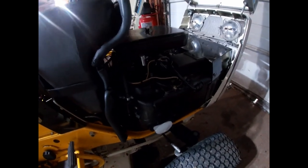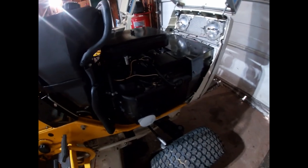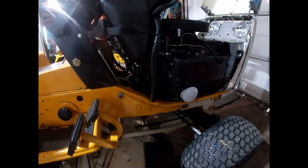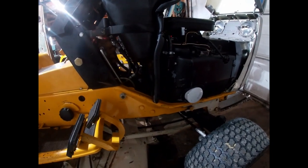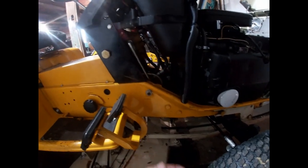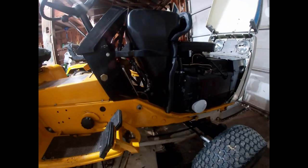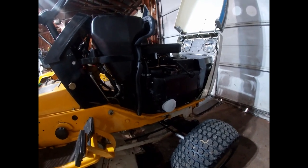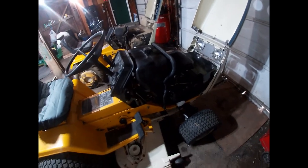It's the same basic concept, just a little different than the 318. The Cub Cadet tractors don't use vents on the side panels, but they do pull their air from underneath the tractor, as do many different garden tractors using this style of engine. The concept of airflow for these tractors applies to even current models using V-twin engines — like an X700 series Deere or a Simplicity with a V-twin, they all pull their air from the center of the tractor.